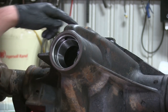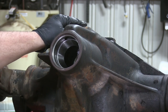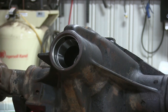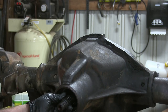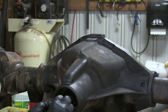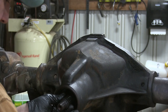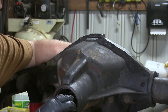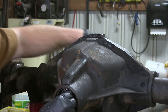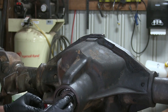We're going to do the same thing for the pinion on the inside, but we got to remember those shims that we took out. I've already put that one in and I got those shims behind it, so now we're ready to start piecing everything back together. The pinion is back in - this one did not have a crush sleeve, instead it had shims. We're going to take our new bearing that we've lightly oiled and slide it in. It also had a shim or a thrust washer behind the bearing.